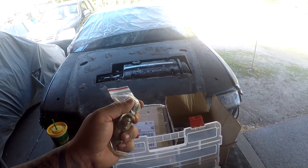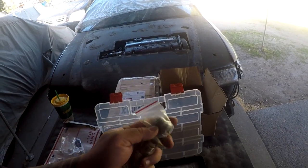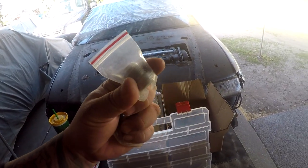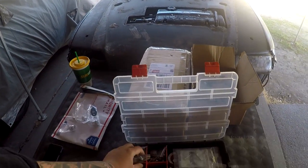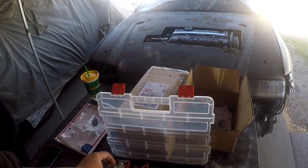ready to swap the oil out, so that way I can drain the pan, take the pan off, put the new gasket on, and tap this while we're at it. And this right here is the dash 10, and over here I got the dash 10 cap for plugging up this guy on the pan so we don't leak oil when we're running it still as all motor.